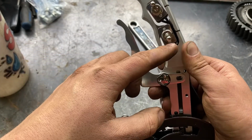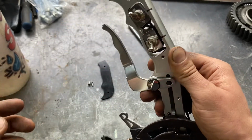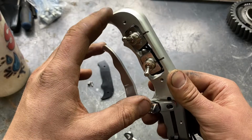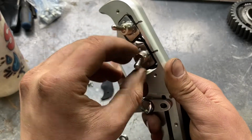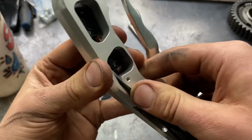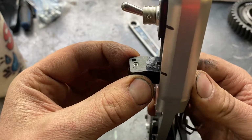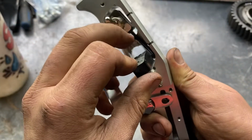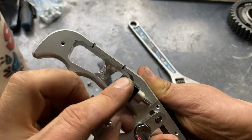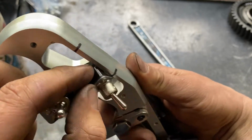I might make a second reference line for this over here. But make the holes a little bit bigger so you have a little more wiggle room. It helps out. Also, this top switch fits awesome, and all the wires will tuck in nicely behind here, but the bottom switch gave me some trouble, so I had to file it down, as well as take a die grinder and grind out this inner piece a little bit right there to help fit the bottom switch.